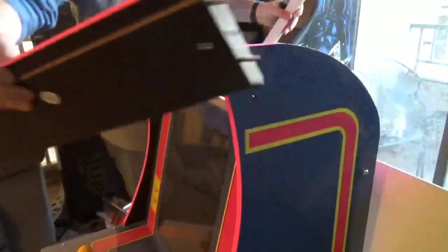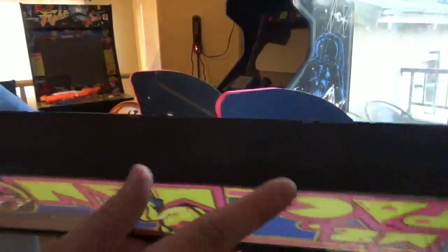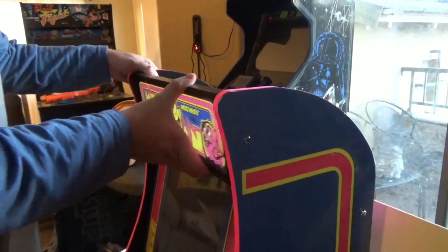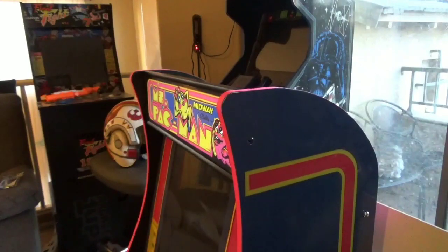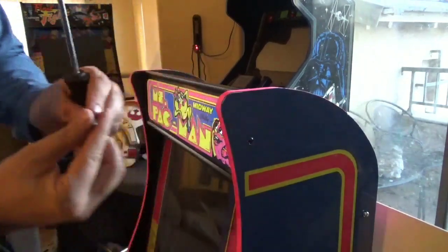And away we go. Okay, time to get to the good stuff — we're ready for the mounting. Now that we have the original stock blackout board connected to Angel's marquee using the same three screws that came with that board, definitely make sure that you have the screws nice and tight so that the seam is flush. If you don't have the screws nice and tight, you're going to get some light bleed coming out the bottom. Now it's just a simple step of getting everything put together — we've almost hit the finish line. Just need to mount this and grab the two new screws that Angel included with the package, because you don't want to reuse the stock screws — they're just too big and they could wreck the marquee.